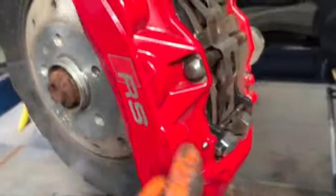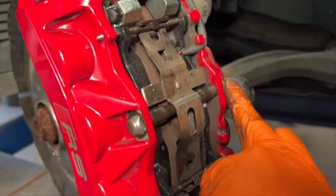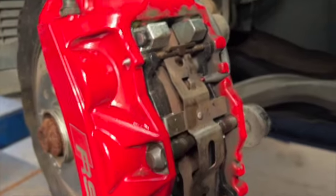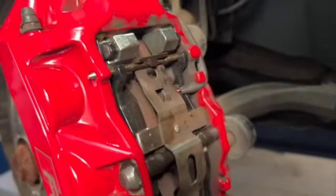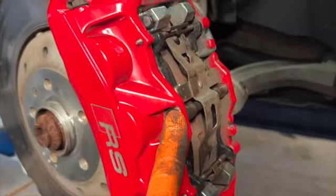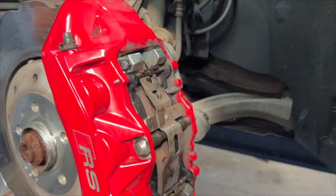Okay so we're all back together — we've greased the pins, cleaned them, greased them, that bolt's nice and tight. That is 25 newton meters — or 24, I will double check while I'm doing the rest of this video. Hub's been cleaned back and some anti-seize on there, pins are through and on, the sensor goes down, round, and connects. It is 24 newton meters for this bolt here — caliper guide pin, 24 newton meters.